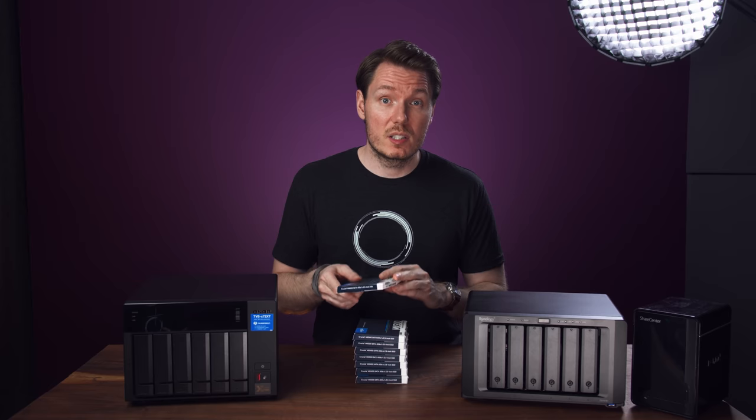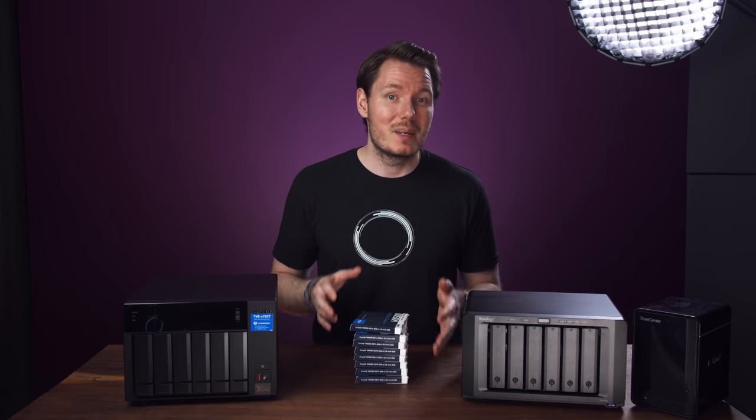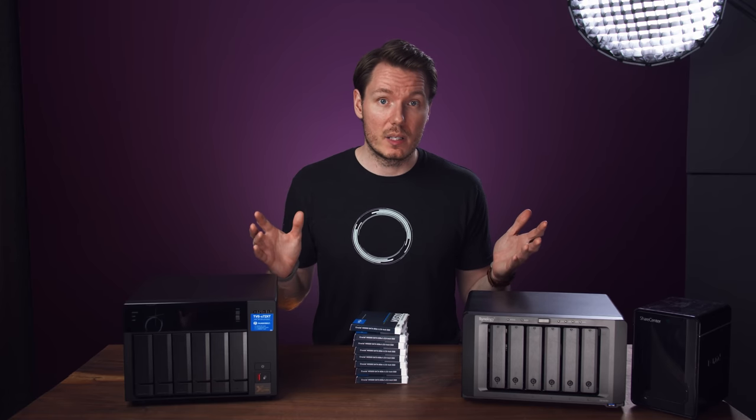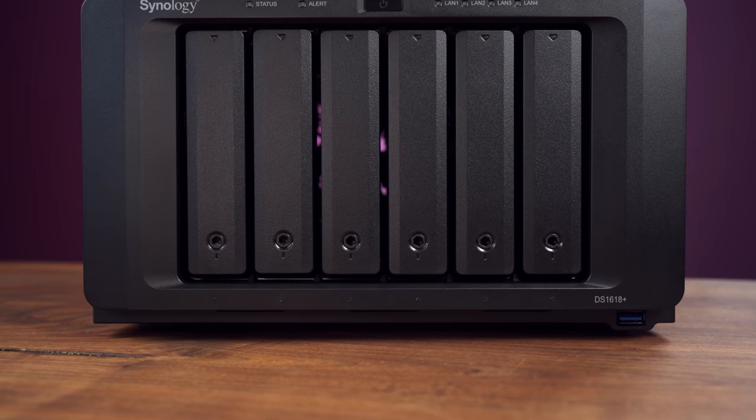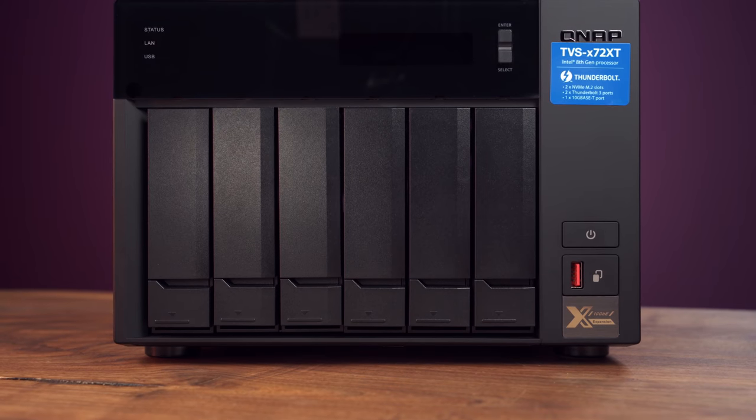Economically it was better to buy spare drives than longer-lasting ones, but if you're doing this yourself, look for the most TBW you can get for the money and buy quality drives. I figure 700 TBW should be fine since I'll only cycle about 10 to 15 terabytes per month, giving me at least four years of use. I reached out to Synology and QNAP to send me a NAS fitting the bill, and here's what they sent: Synology sent their DS-1618+ and QNAP sent their TVS-672XT.